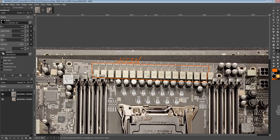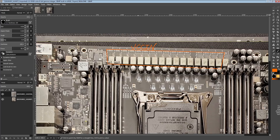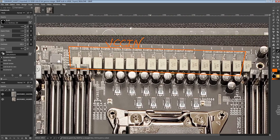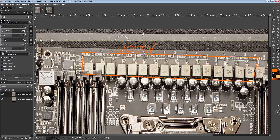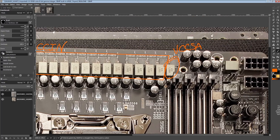From an overclocking perspective, KBL-X is pretty neat. I really wish you could get a Coffee Lake X CPU — like a 9900K with similar improvements. The 7740X, if you've ever looked at the delidded 7740X and compared it to a 7700K, the reason why 7740X's clock better than 7700K's is very obvious if you look at that substrate. The power delivery on 7740X's is just much better than on 7700K's.